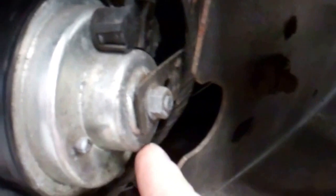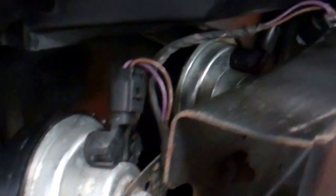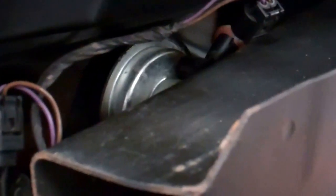We'll start with the easy one: the horns. So we've got it all ready. One thing you'll note is when you fit this front bumper support panel, the horn is a little bit close and you can't get the connector on the top. So what you've got to do is loosen one of the nuts on the horns so that you can rotate it and get that connector on there. That's easy, no stress.